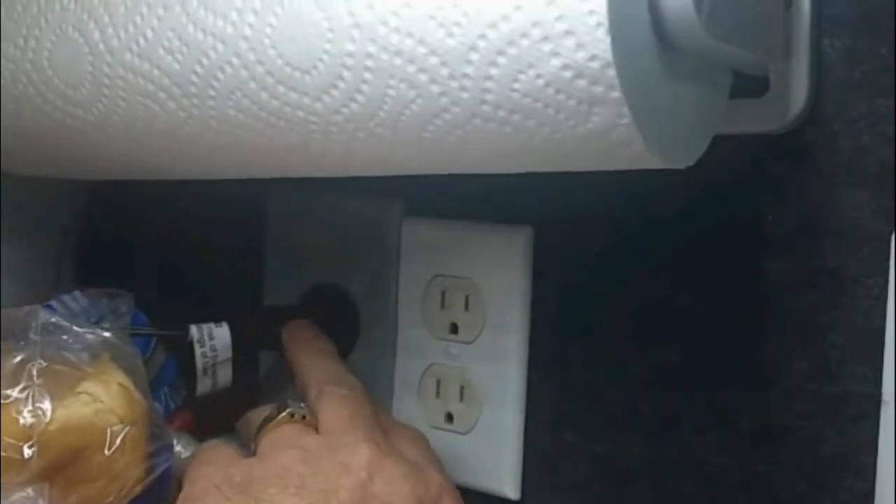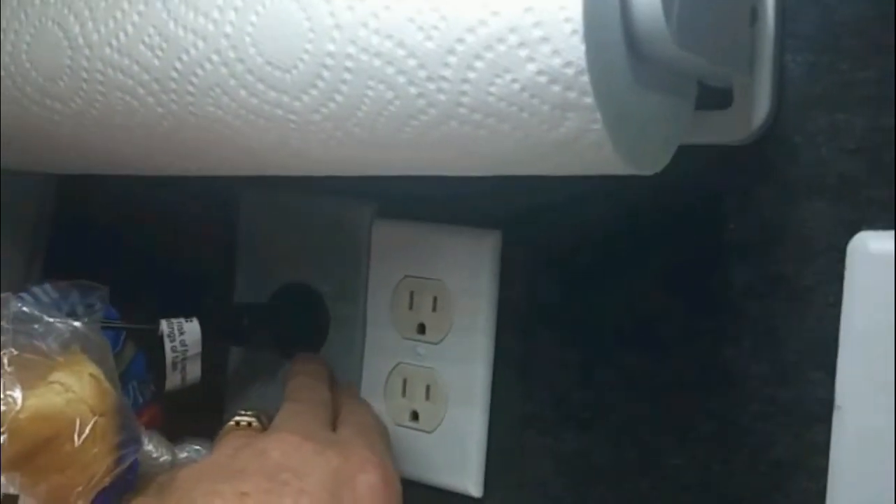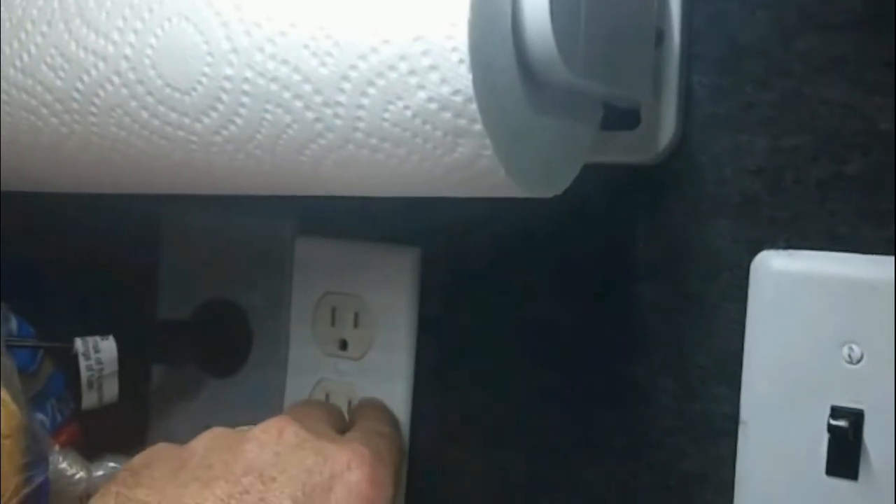Entering from the back: my overhead lights are wired to a switch that runs directly through a fuse. The overhead lighting is LEDs, so they draw virtually no amperage. I have another 12-volt port also connected directly to my marine battery. The only other electrical items back here are the mood lights under the sink — also LED, drawing no wattage — and my 12-volt cooler, which has its own built-in fuse. So everything is fused and safe.